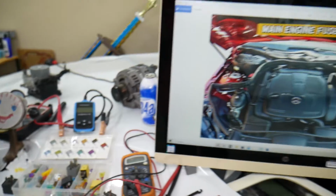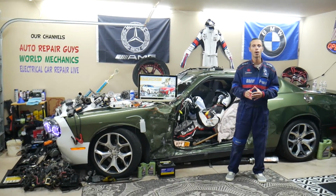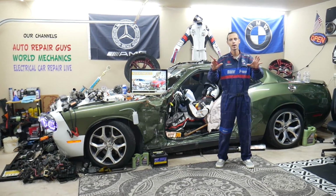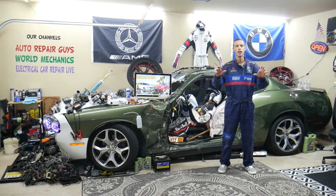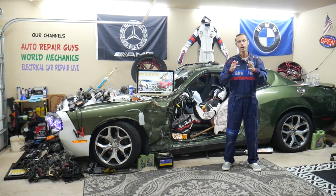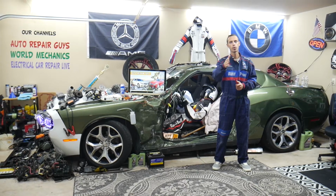We recommend that you always check your climate control fuses. If you want to see that video, it's on our channel. But usually what causes the heater to blow hot air on the driver's side and cold on the passenger side could be a simple fix. You have a dual zone climate control, which means the driver and the passenger can adjust their temperatures. To do that, you have one heater core, but behind the dash you have two devices known as blend door actuators. Those are little motors attached to a flap, and that flap regulates from hot to cold temperature.